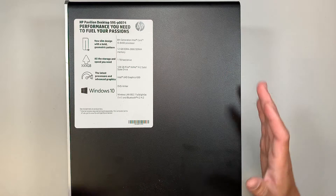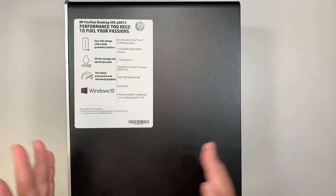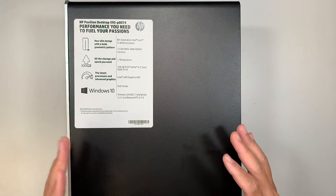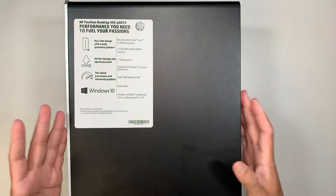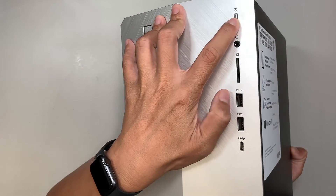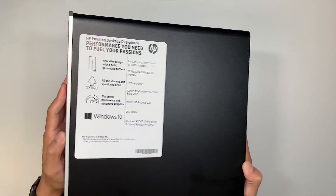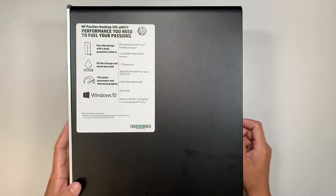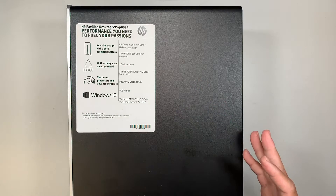Let me tell you what happened. The day before there was a power outage and the surge protector probably did not stop it. The next day when I tried to turn on the computer, pressing the power button in the front, there's no white light — it's stone cold. It does not power up and nothing happens.